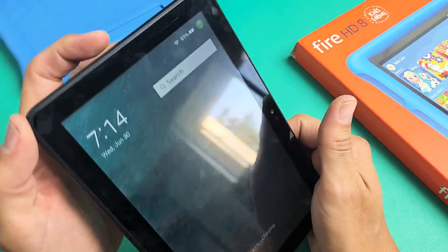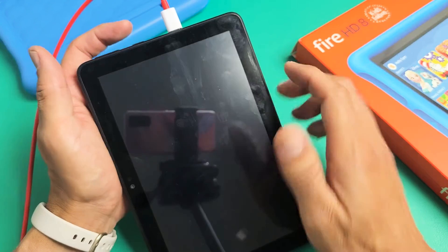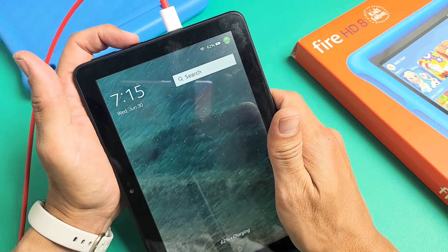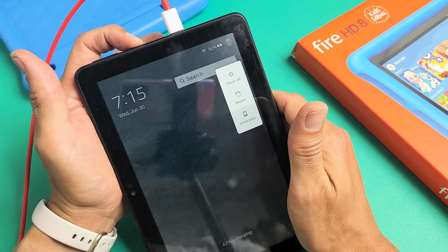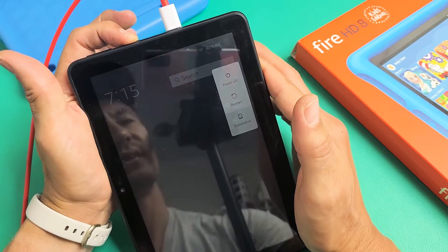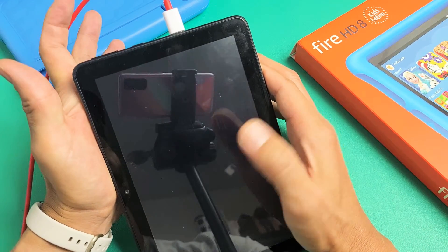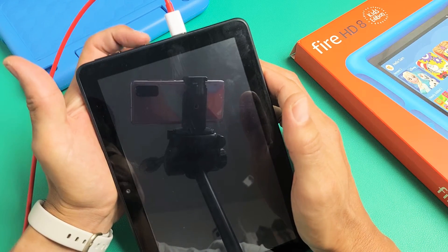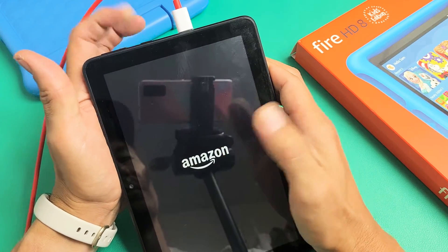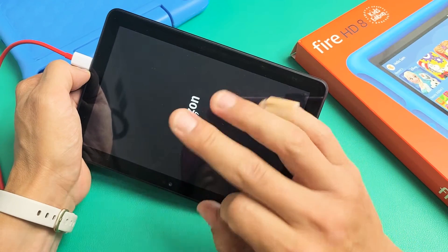Let's pretend my screen is totally black again. We're going to do the same thing — power button is up here. Press and hold for 15 seconds. After 15 seconds, let go and it's going to basically turn it off. Then press and hold again to turn it back on. Counting to 15 seconds while holding — then let go and it should be totally off. Now press and hold the power button again for about three seconds, or until you see the Amazon logo. Let it boot back up and hopefully you no longer have a black screen. If you still do, we're going to go to option number three.